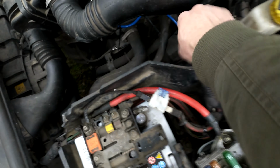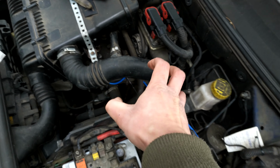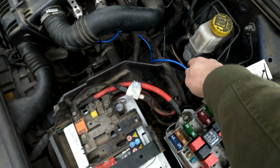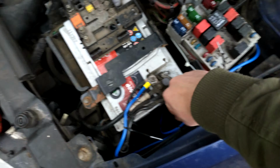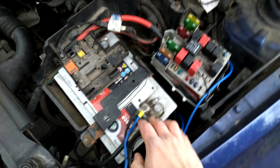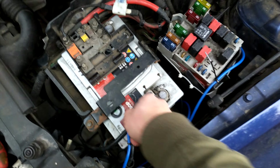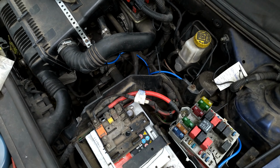So this is basically done. The reason why I made it so tight with other cables, but I also put some slack on the cable itself, is because I know that the engine will be moving around, and this could cause the cable to tear. But as it is now, it has enough slack. I also have a bit of cable left, but let's keep it here just in case I have to replace the connector or something like this without replacing the cable completely.